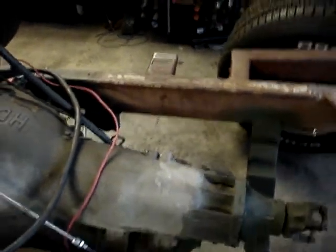Looking good. I cleaned the floor, as you can see. I had crap everywhere - got that piece of wood off with all the tools. Flows nice and clean. Everything is brand new. My brake line jumps to the frame. I think I'm going to go east with that, go around the back and come up to the front. Or I don't want to jump the frame or go all the way out to the front - that's kind of stupid. Maybe I could put a brace here. I can go back and around, all the way up to the junction block, which is probably going to be about right there underneath the firewall.